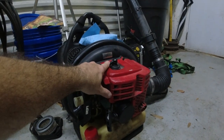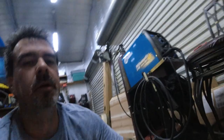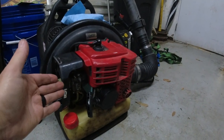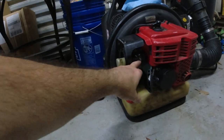Maybe I'll put the old coil back in and see how much spark comes out of it compared to this one — see what kind of spark this one produces. The coil wire broke on the old one so it's too short now, but I can rig it up just to test. If the old one gives a hotter spark, I'll get another ignition coil. They're not that expensive. Maybe something's also screwed up with the carburetor — I think I replaced this carburetor once already. Carburetors are cheap too, maybe I'll just do that.